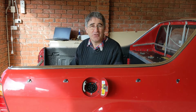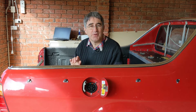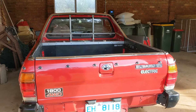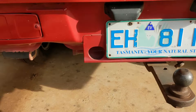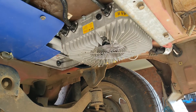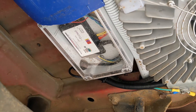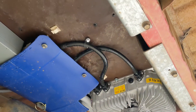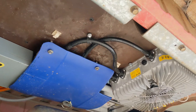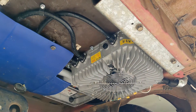In this video I'll take you through the completed installation of a new charger in my electric Grumby. I've got an N-Power charger controlled by a Thunderstruck Motors charge controller, and that charge controller lets me put in a Type 2 socket. The charging hardware is underneath the car. There's the N-Power charger in its aluminium heatsink and fan, and in front of it is the EVCC, the charge controller. I've got a blue cover there to hide all of the wiring. You could get rocks and splashes of water under here, and the charger is reasonably waterproof.